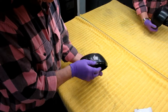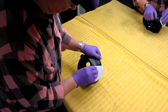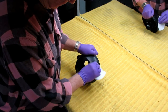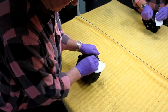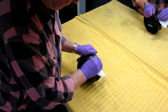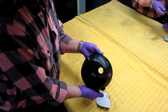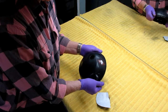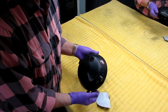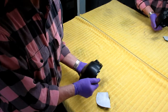I tried to find all the spots where rust was coming through and hit them with 60-grit paper. This also has red primer on it — maybe that's the paint they used in this era. A lot of times with older bikes, even the RDs, there's a compatibility issue: they were painted with paint that when you put modern paint on, you get alligator skinning and bubbling. So I think it's going to be to our advantage to just get rid of all the paint on the surface you're going to see. Get rid of all the paint, start with bare metal, get a fresh coat of primer. The value of these parts — they're just not replaceable; you can't call up some dealer and find one for 20 bucks.